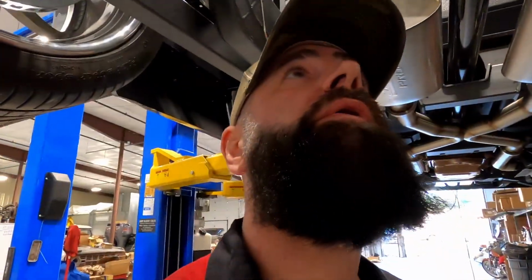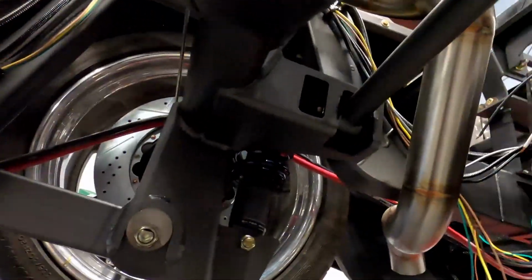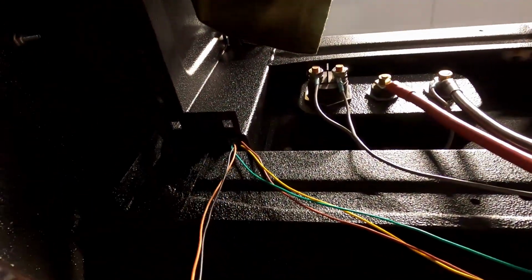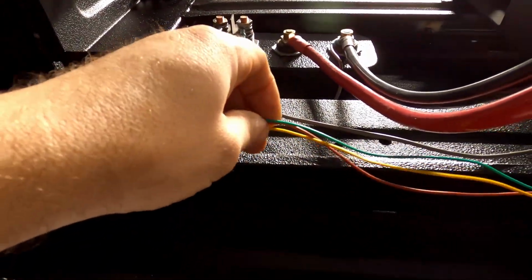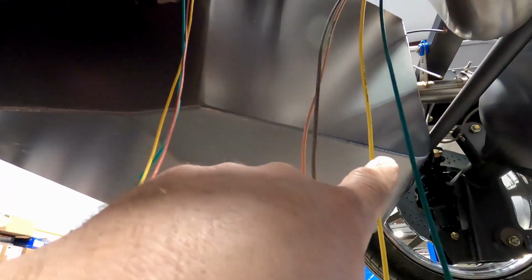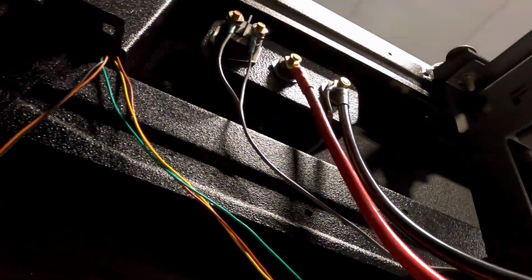Got right into it. George gave me a hand and then had to take off. We are running wires. We have our wires over here for our Alumacraft taillights. So these wires run a dedicated power and ground, and basically have an internal solid-state relay type setup, which then uses your actual wires from your regular lighting on that. So it doesn't use these as a power feed to power the lights, and basically just a trigger signal to turn on whichever relay to turn everything on.